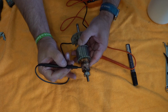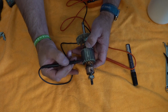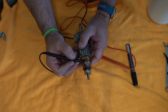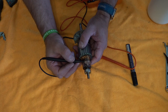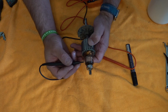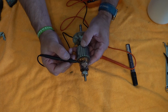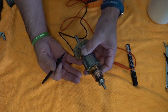The final test is from a bar to the shaft — you should not get any continuity there. If you get continuity, something is definitely wrong with the armature. If you get a spike between bars, you've got a broken wire; a dip means a short. You can run a stanley knife through the slots to try to clean out a short, but nine times out of ten the fault is down in the windings. It's easiest to just replace the commutator or armature.